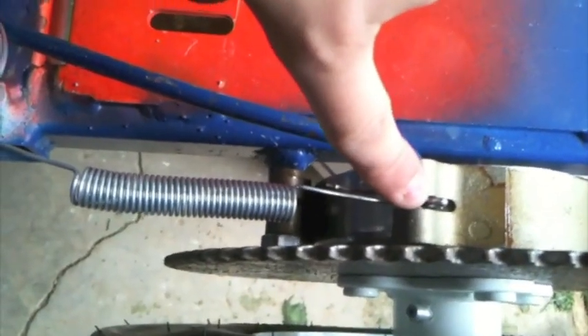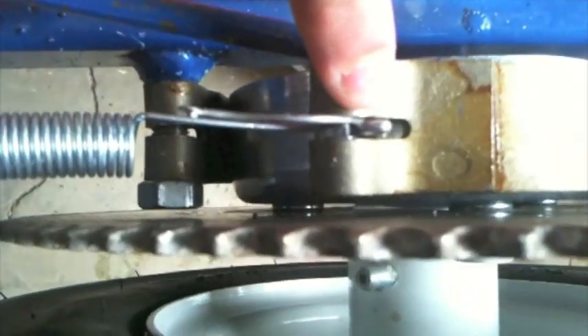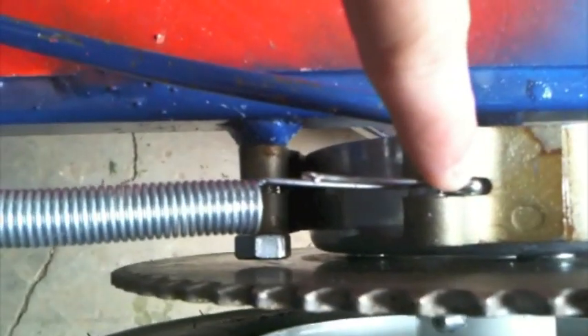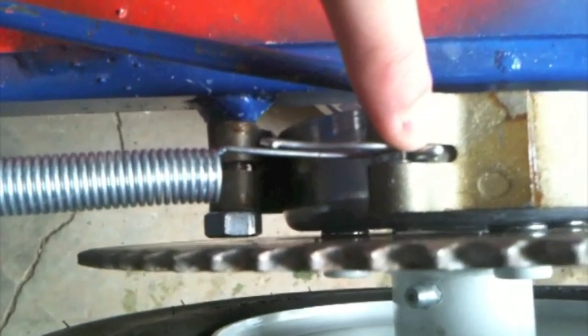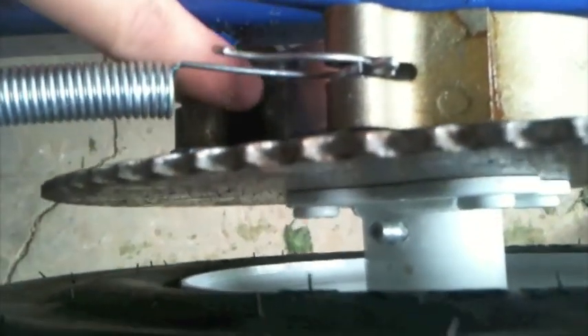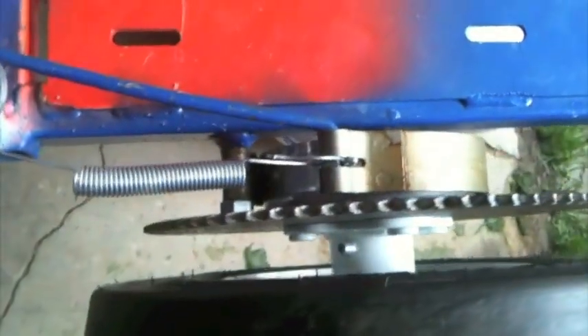Put it halfway through there. On your brake rod, you should have a cotter pin hole. So you're going to put a cotter pin in there, and you're going to twist both ends so that they go in opposite directions. Make sure that they're not rubbing against the drum.